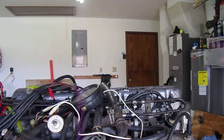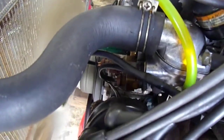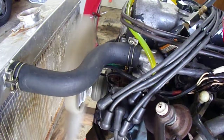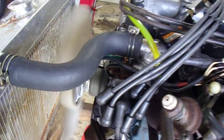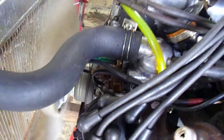Well, anyway, that could even just be the variation in the sensor. And I don't know how old that sensor is or how accurate it is. A new sensor might resolve that. Perhaps that sensor or the wiring of that sensor, maybe that sensor is not outputting the correct resistance for the water temp. Whatever. That seems to be fixing it perfectly.